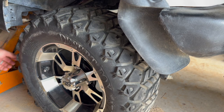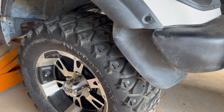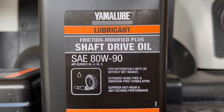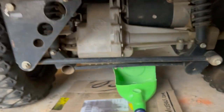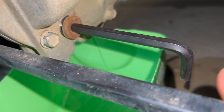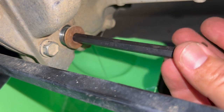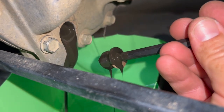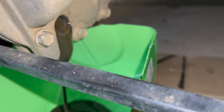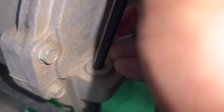With all that done, I can safely remove the jack stands. Now that everything's reassembled, I need to put in new friction modified plus shaft drive oil — this is Yama Lube lubricant, which I found at a local ATV parts dealer. The last step is to drain the oil. I have something to catch it under here and I'm removing the oil plug, which is just a hex key or Allen wrench. I'm going to let the remainder of that oil drain out, then remove the fill plug here, and that will allow it to drain a little bit faster, and then we'll be able to fill it up.